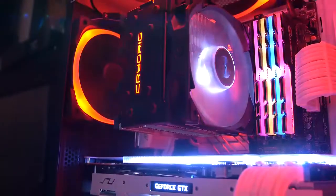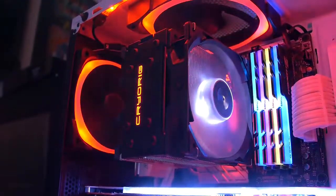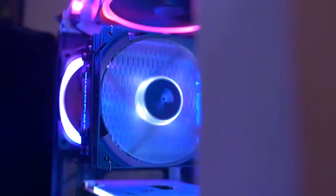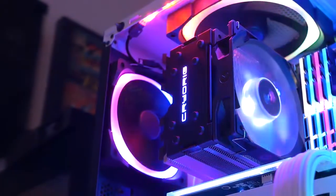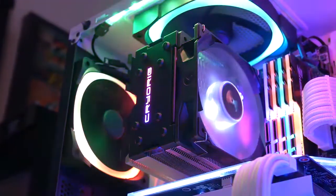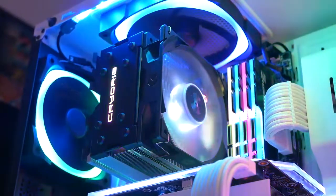You can see one of them right there. If you guys remember this build, it's rocking a Skylake Core i5 6600K, overclocked to 4.7 gigahertz at 1.4-ish volts thereabouts. And actually, this cooler had no problems handling it. We did GTA 5 for about 15 minutes or so, as per usual, and we didn't see temps go over 69. We were pretty much hovering in the 50s 90% of the time, with occasional peaks into the 60s.